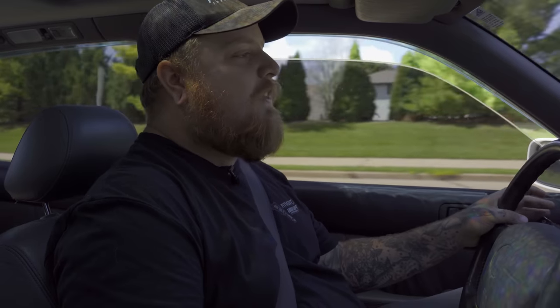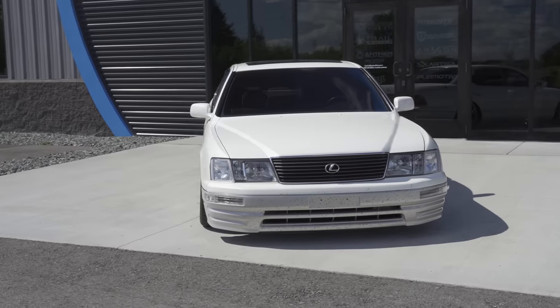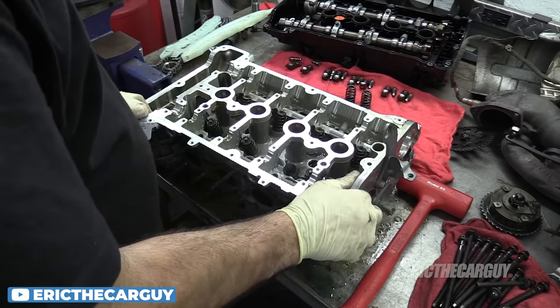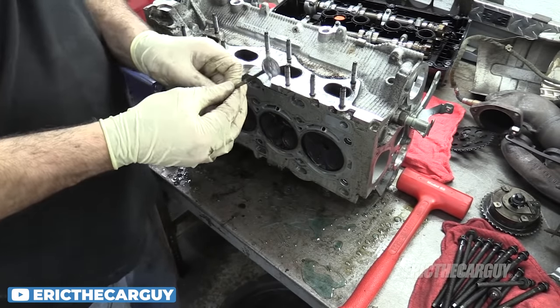It just depends what you want to do with it. This is more of the low and slow gang — it does have the V8, but by no means are you going to be beating people in every race. One thing to think about if you're picking one up: the '90 to '94s don't have an interference engine. You're still going to want to replace your water pump and timing belt, but if the belt goes early, it won't lock up your engine. However, the '95 and up cars are interference engines — if your timing belt snaps, there goes your engine. Regardless of whether it's interference or not, check that the previous owner did a timing belt and water pump, because you're going to have to do one. Don't avoid it, do not put it off — that's how catastrophic failure happens.